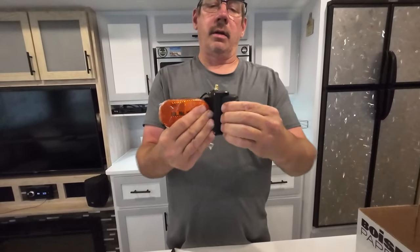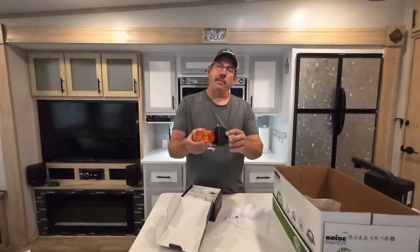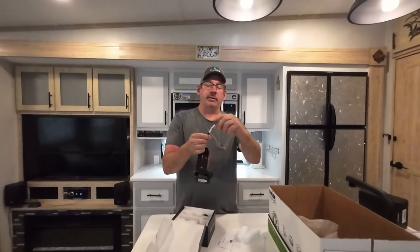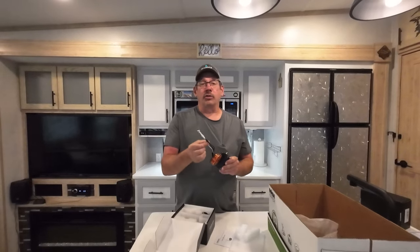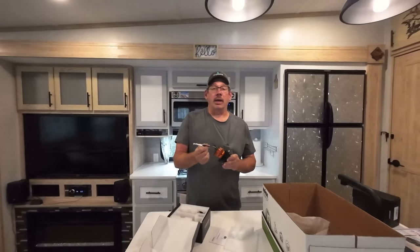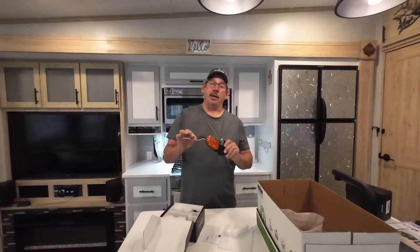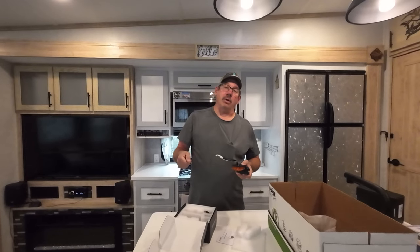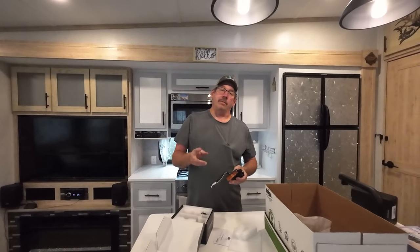This does pivot, so you can angle it out pretty good ways. Like the other two cameras, it has a pairing button and two pairs of wires in the back. One pair of wires hooks up to your running lights, and the other is your power for the camera. I'm hooking it up separately — a lot of people will just hook this up to their running lights, and then you have to turn your lights on in order for the camera to work. I have a switch in here that operates the cameras, so I'm going to hook them up differently.